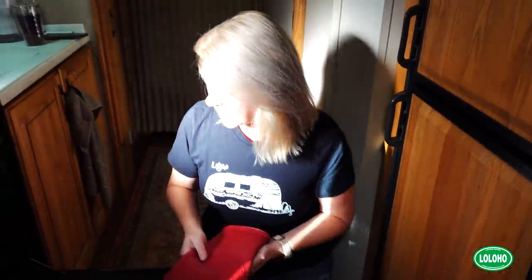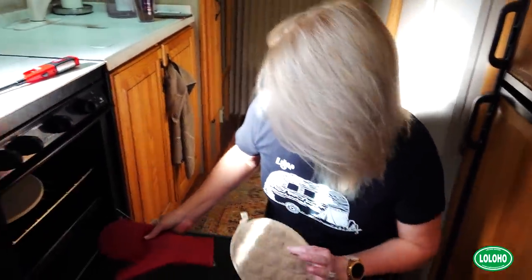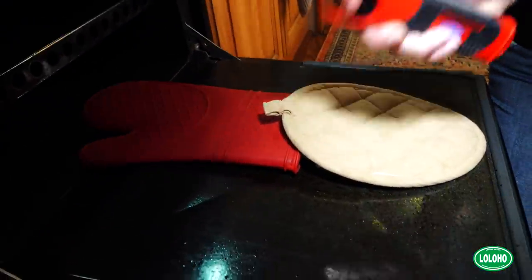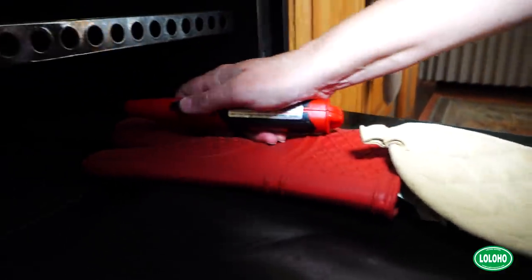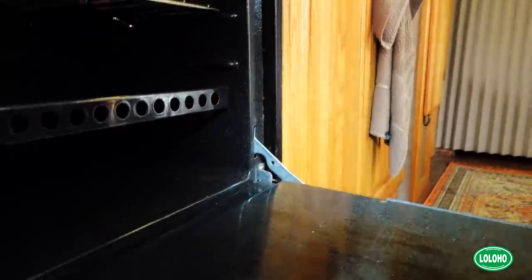Something else you'll want to make sure you have are several oven mitts. This is in case your oven goes out for some reason and you have to relight it while the oven is still hot, or if you turn your oven off and then realize you need to put something back in and relight it. What I do is take a couple of oven mitts and lay them down here so that when I reach in to light the pilot light, I can rest my hand on the oven mitt so I know I won't burn myself. That's just a little trick I use if I ever have to relight my oven while it's still hot.